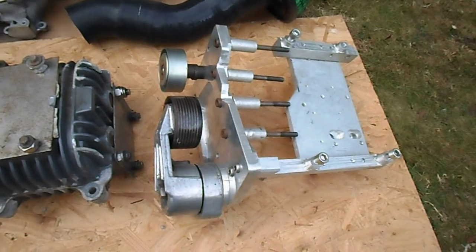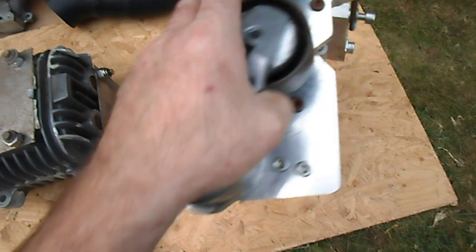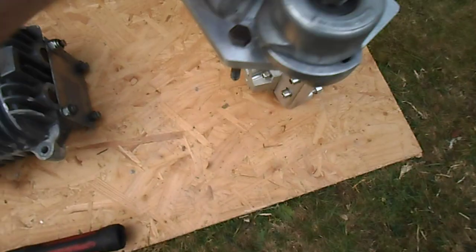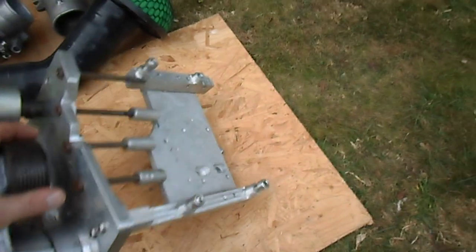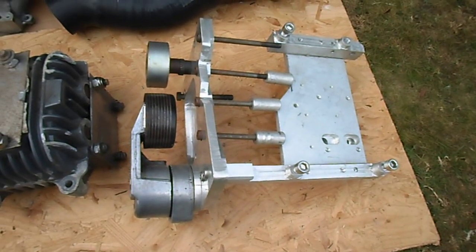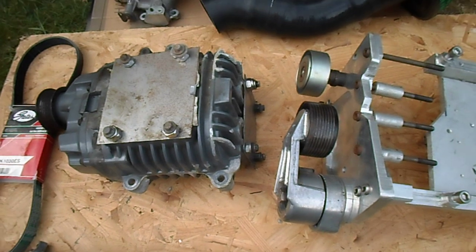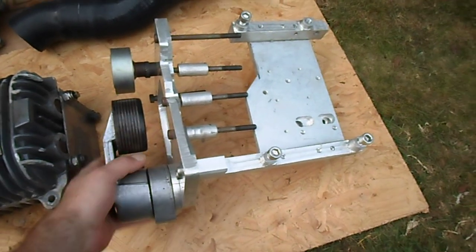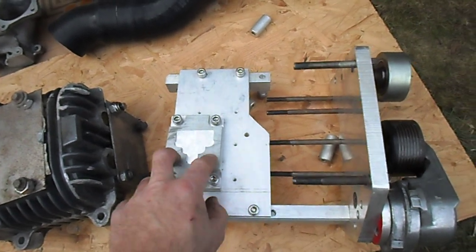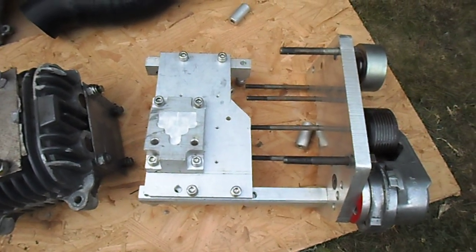This is the mount I've made. It's based on the old aircon pulley bracket but with the same mounting holes here and here. The original mounts are there basically. I went a bit overkill with the aluminium thickness, but I didn't want it to break - and you know, what's a couple of grams. I've machined out what I'm happy with, just need to radius the corner. It mounts on the side of the block here and here on the front of the block. It's quite strong actually - doesn't have any flex whatsoever.